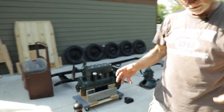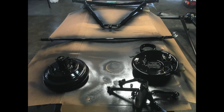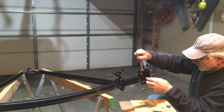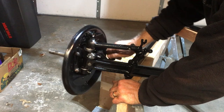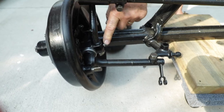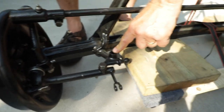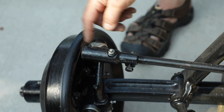For the front end we did a lot more work. I went through the brakes and bearings, cleaned everything up — the brakes were in such good shape I didn't have to do much. I replaced the kingpins, which was a big project. Our club, the Twin Cities Model A Ford Club, has all these tools we can loan, so I took out the old ones, put in new bushings, and added new grease fittings all over the shafts. We also put in new bushings for the springs on the perch, and the new spring is all ready to go with new shackles.